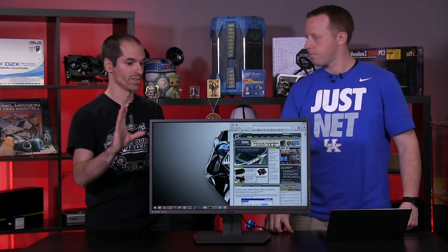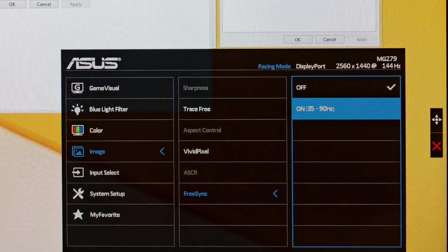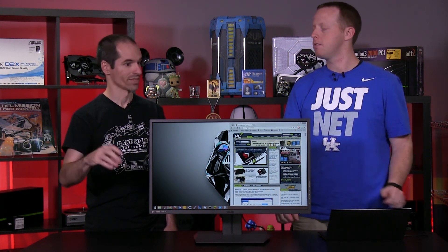However, this does not come with FreeSync enabled. You have to go into the OSD and enable it. So when you first plug it in, it just doesn't show up as a FreeSync panel — we were scratching our heads initially. When you turn on the OSD, the display actually reinitializes — it almost reboots. Windows kind of sees it as a different display, you hear the connection chimes.